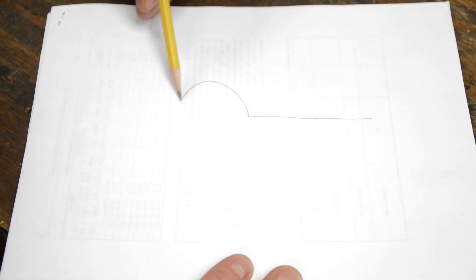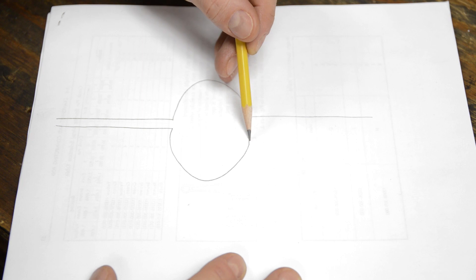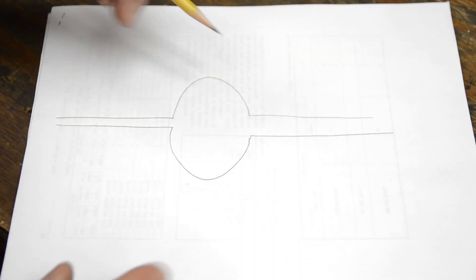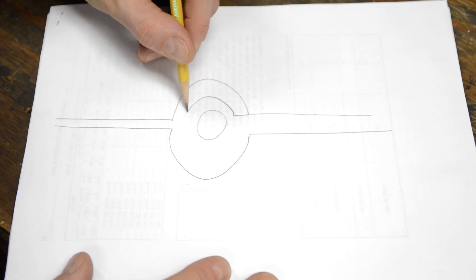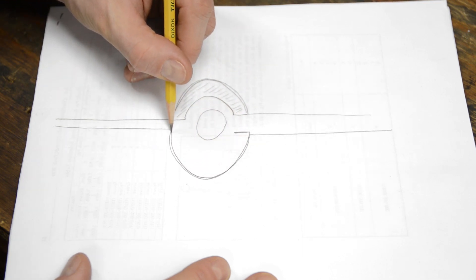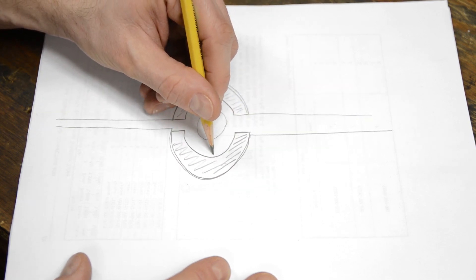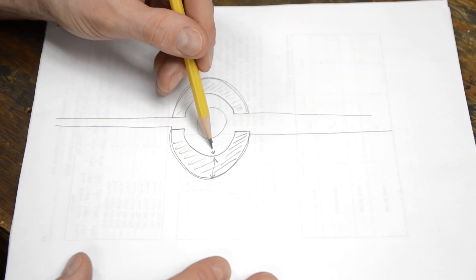Here's what we're trying to do with measuring the oil clearance. Here's the top crankcase half and here's the bottom — I'm drawing this sideways so this is kind of screwy. There's the bore diameter when these case halves are together. Here's your crank pin, and then you're going to have bearing shells. This is the dimension we're measuring or trying to achieve — this is your oil clearance. The thicker or thinner bearing will determine this dimension.